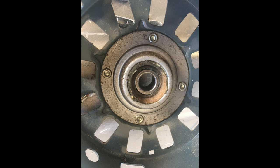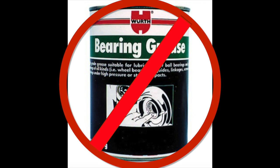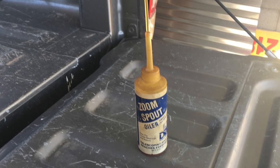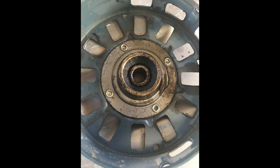The amount and type of oil to be reintroduced back into the bearings is important. Putting too much oil is just as bad as not having enough. You might come across people who say you can use grease — this would be a mistake, in my opinion, as grease eventually dries up, hardens, and will gum up the Permawick material, not allowing it to lubricate the spinning shaft. Use light oil like Zoom Spout or 3-in-1, the one in the blue can. Because both bearings on this motor still had oil in them, I only put about 5 or 6 drops into each bearing, going around in a circle to ensure the bearing was evenly saturated. Putting in so much oil that it runs out of the bearing is a mistake and can ruin the motor if this excess oil is thrown into the windings while it is running.